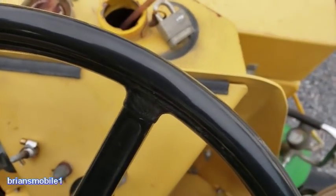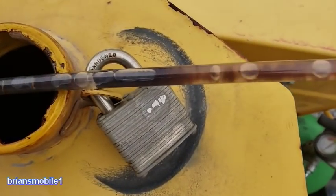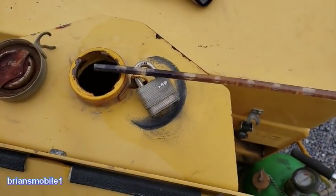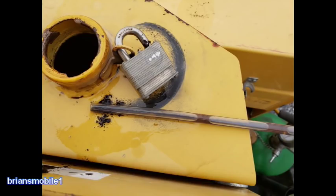Then you pull it up a little higher and you see all that rust in there — I can't even get it to go up the tube, let alone through the fuel line. As long as I operated it on the flat it was fine. As soon as I got on a curve, all that rust spilled into the bottom of the tank and plugged it up. That's what was causing the up-and-down idle — it would plug and free, plug and free, die and stall. It was just a bunch of rust in the tank. Perfect tool to diagnose that.